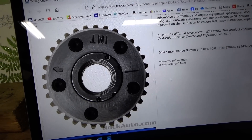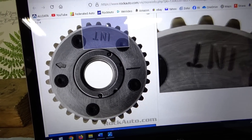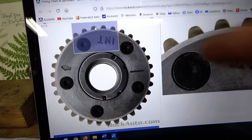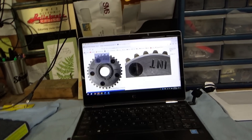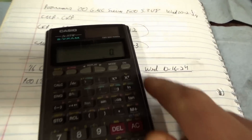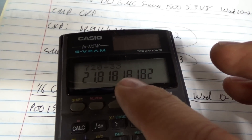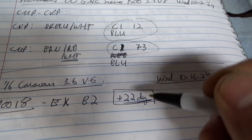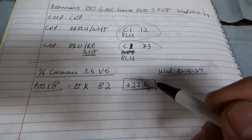Let's look up a picture of these cam sprockets and count the number of teeth. We have 33 teeth. So, one camshaft revolution is 720 degrees of the crank. We want to divide 720 by 33 to see how many crank degrees equals one tooth on the camshaft. 720 divided by 33 — look at that. Very suspicious: 21.8, basically 22 degrees. Our live data was saying plus 22 degrees. So this exhaust bank two is advanced according to the computer.